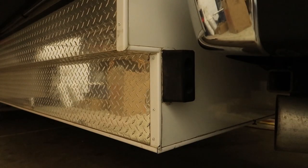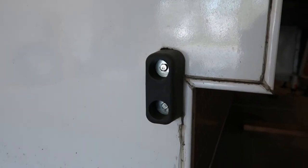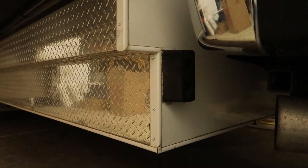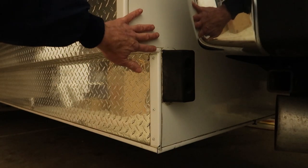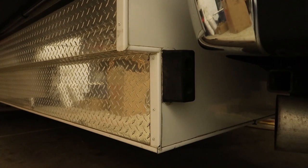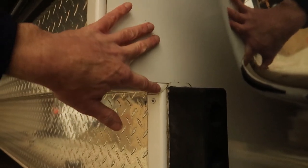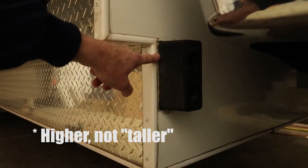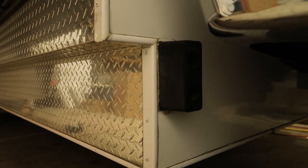In a previous segment I was talking about how the bumpers were up high — you can actually see that in that video clip. That was a 2010 811. I now have a 2018 992. The top of the bumpers is even with this portion right here. On the other model, the spot for the upper mounting hole was about another 2.5 inches taller. So with these bumpers they're lower than that bend in the sheet metal, but I still want to use my spacer board so that if the camper did shift, it distributes the load across the entire front of the truck bed.